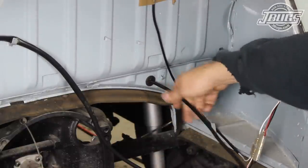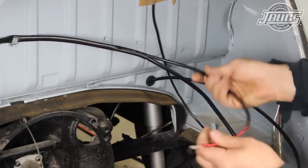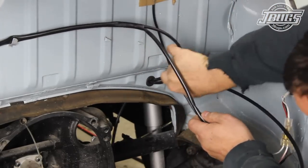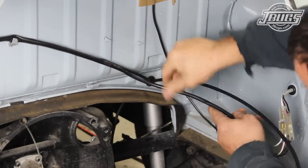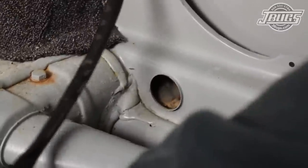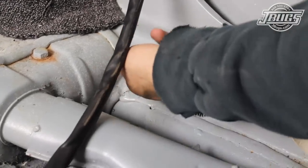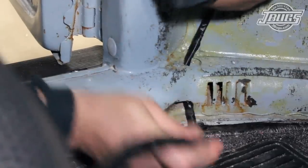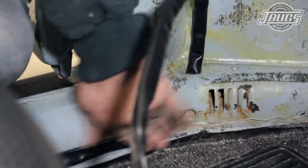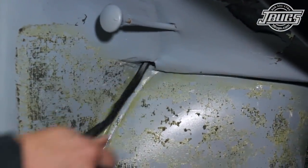From the main harness, the long leg of the harness is going to be routed to the right side of the engine compartment, as it is the wire from the ignition switch to the starter. A grommet is installed at the hole in the firewall, and the starter wire and the separate sheathed red power wire are fed through the grommet. These two wires will hook up to the starter once it is installed. Now inside the car, the stiff feed wire is untaped from the wiring harness and the harness is routed through the quarter panel, through the hole at the lower edge and along the heater channel all the way to the front of the car. At the left front kick panel, the harness is routed through the hole in the heater channel, up the inner fender well and pulled tightly against the heater channel. Then the harness is pushed up through the hole at the top of the front firewall and pulled up into the trunk.